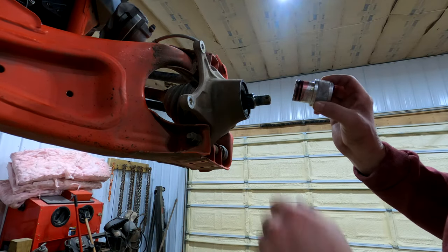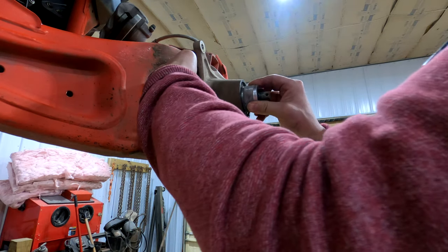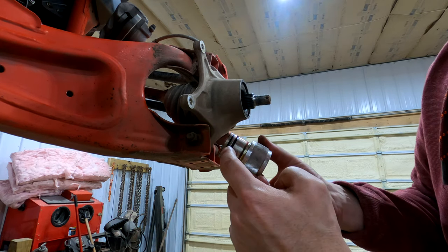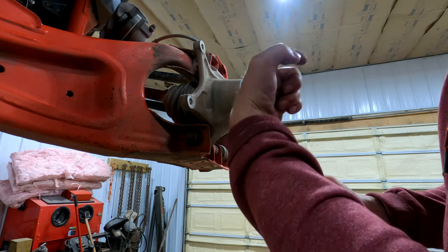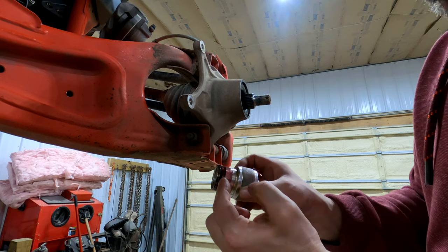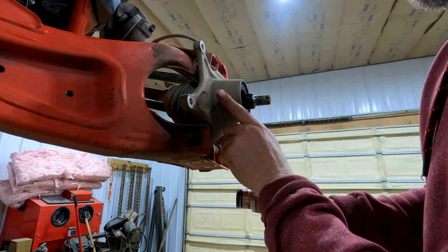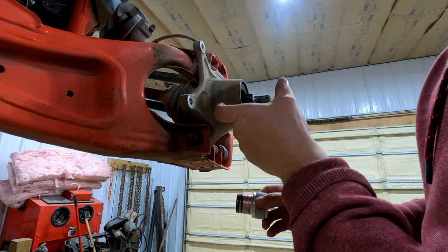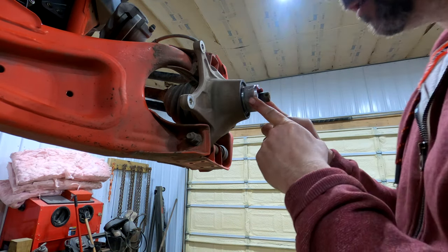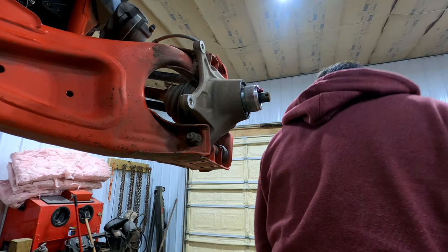Back with the grease tool — goes all over the shaft, all the way in, make sure it's seated. There are two bearings in here and it can only push grease up through the center because the outsides are sealed. It has a channel that this greaser feeds through, with a seal so it forces grease up through and into the back sides of the bearings. It's a nice little tool — about 20 bucks on Amazon, just search 'X3 bearing grease tool.'